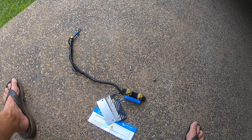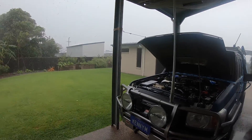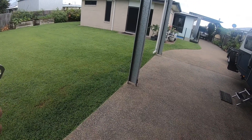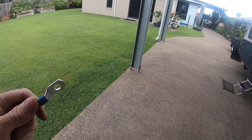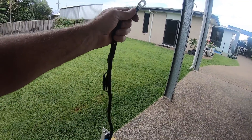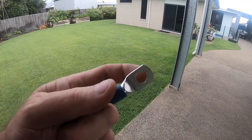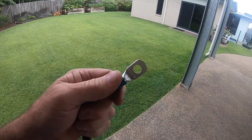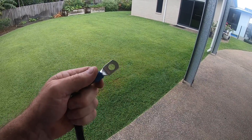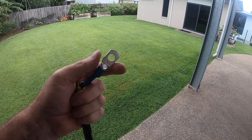I've had to take a little break — yeah the rain stopped. I forgot to mention: the only thing I think is troubling about this setup with the Victron smart shunt and using the temperature sensor is that even without the temperature sensor it had an M10 hole. It's got an M10 hole on the lug, and I think most batteries like mine which is an AGM will have an M8, so it's going to be a little bit loose on the terminal — would be nice to have a bit more flexibility with the lug on the end there.